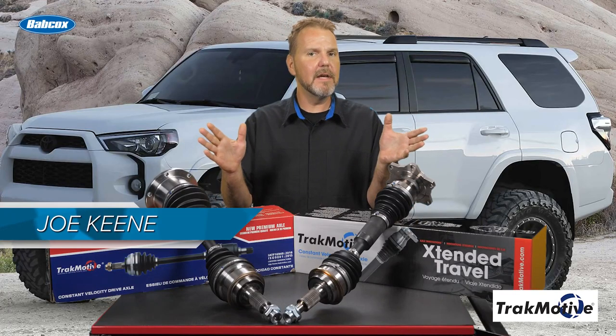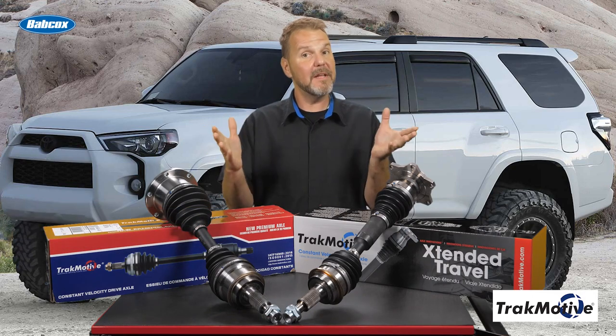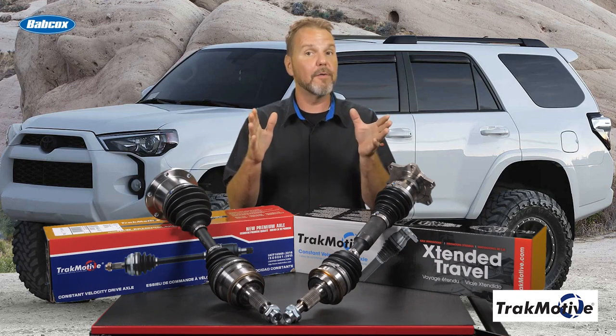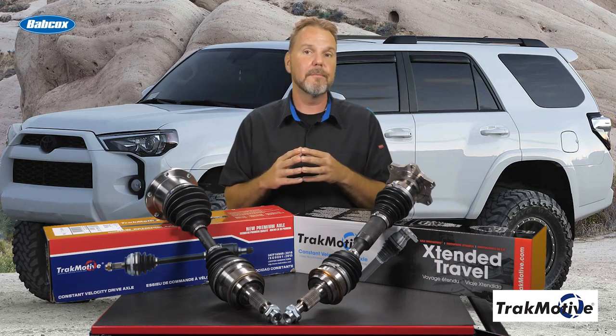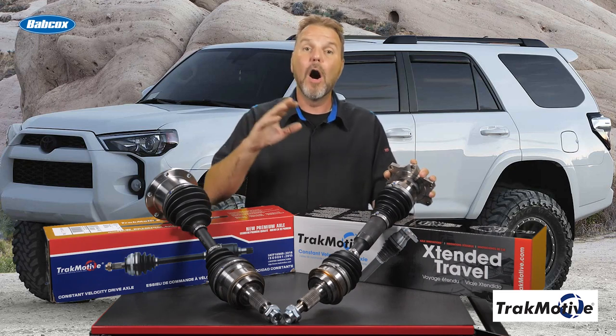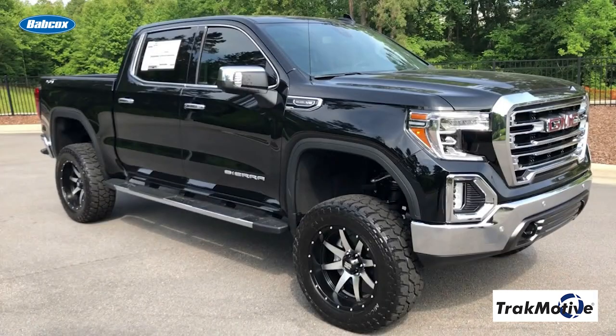When lifting a vehicle, modifications are made to the suspension so that bigger tires can be installed and to provide more clearance under the vehicle for off-road driving. This means the frame and body will be moved up and away from the wheels. This causes the CV axle angles to become extreme, often causing binding, premature wear, and vibrations. On lifted trucks with less expensive leveling kits, the CV joint angle can become extreme since the differential is not lowered to correct the axle angle.